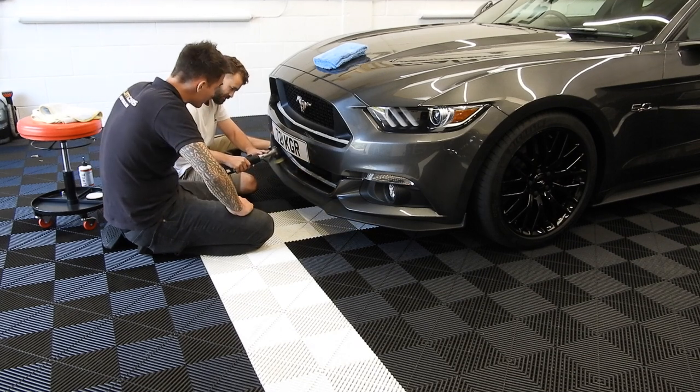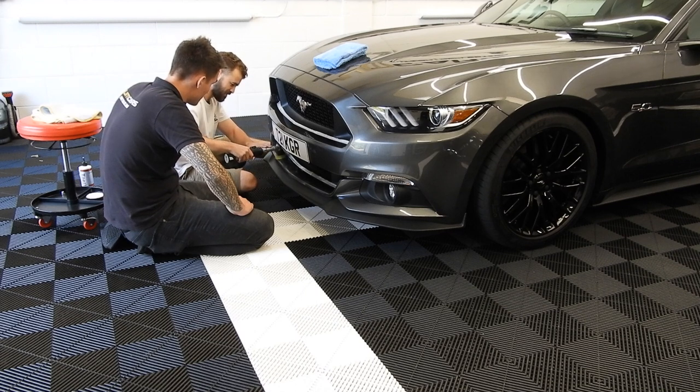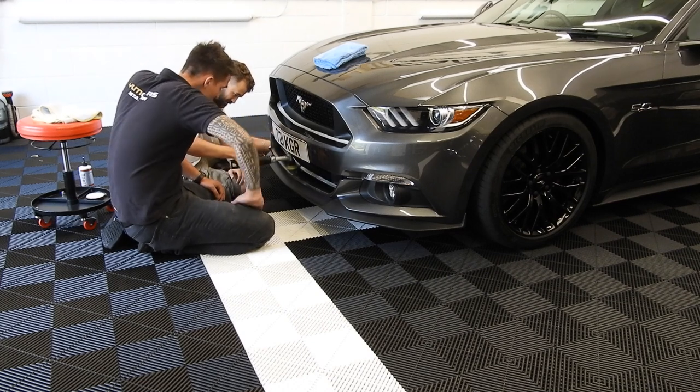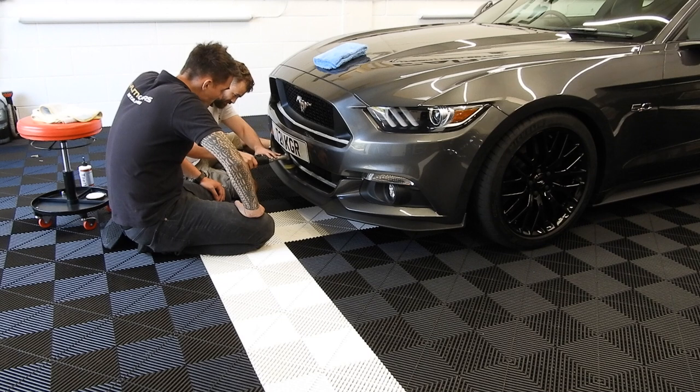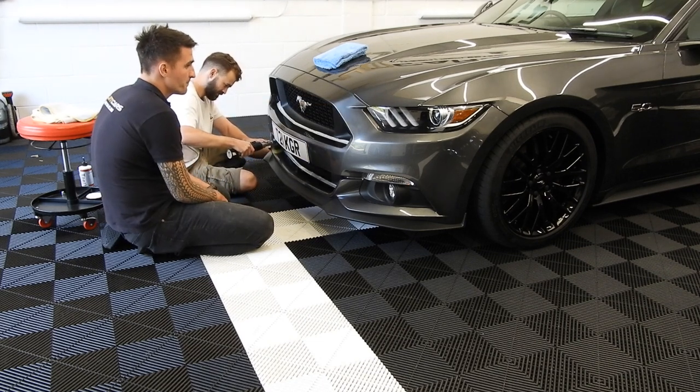At the end of the day, if you don't keep the pad flat, you won't do any work, so you're literally just spreading a polish. After leaving the pad, that's been one of the things. It feels different from the vibration. And you can see you're leaving very even lines there, you can see it in circles. Then eventually, you learn to start to tilt pads into corners, especially on the grooves.